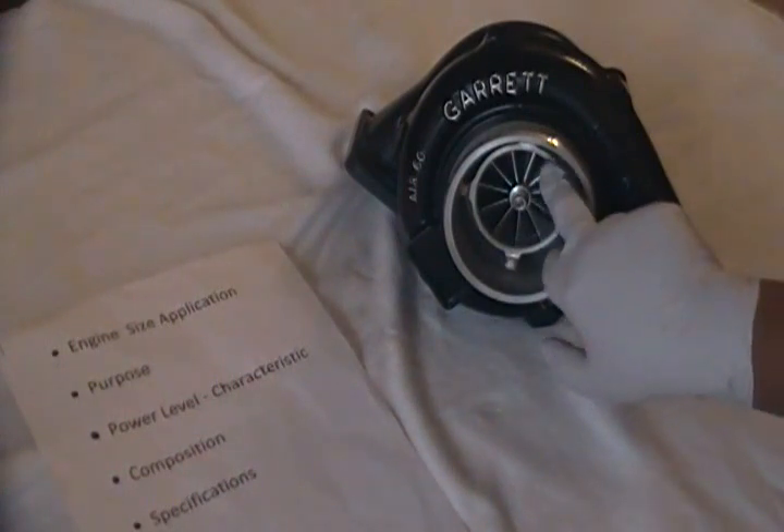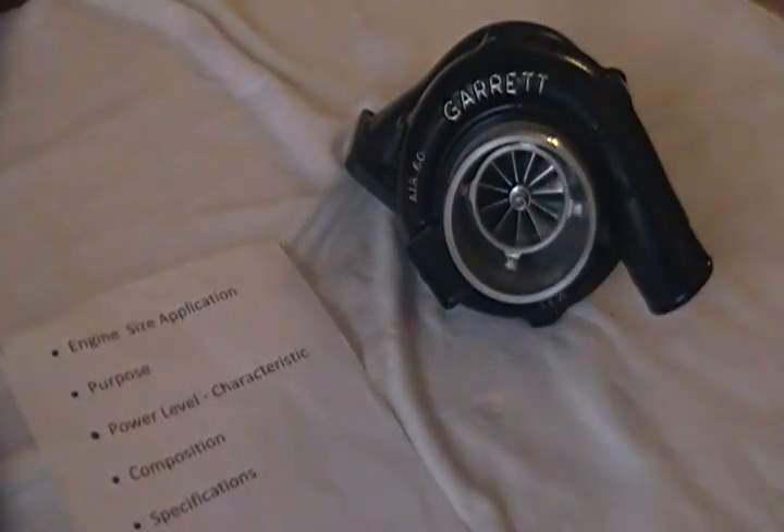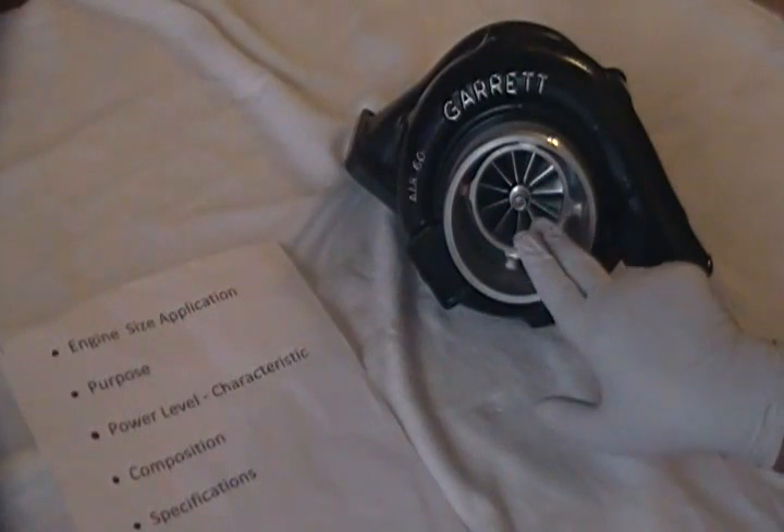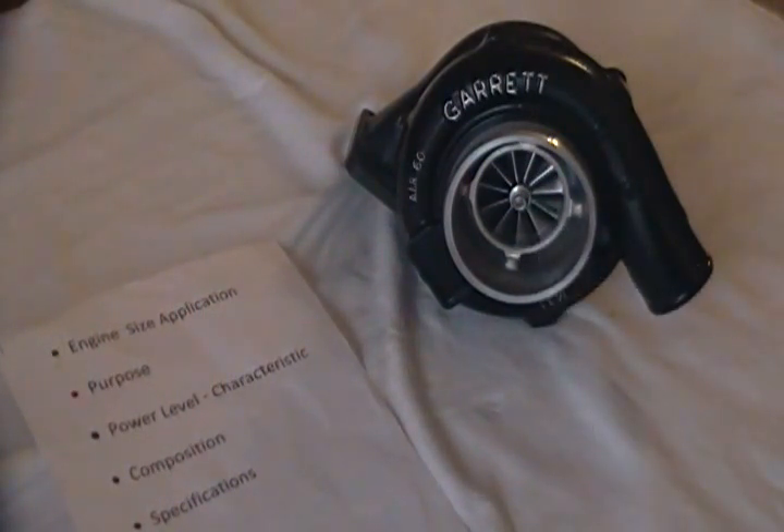The exducer — the larger part of the blade that you can't see in the back here — is actually 76.6mm. The standard GT3076R is 76.2mm. Not that big of a difference, but enough with this change in design to result in an excess of about 30 to 40 more horsepower in the same application.